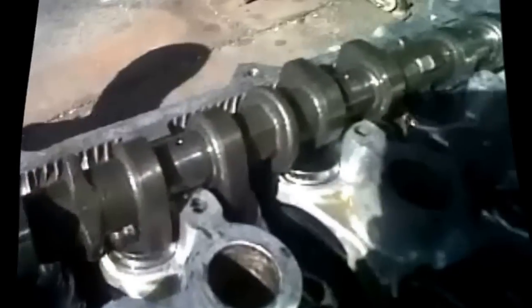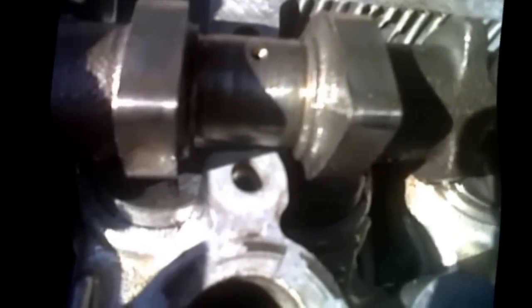You can see this tooth must be inside the other teeth. Now everything is fine. Once we put the tensioner in, it's going to tension the chain on that side. Don't forget — you need to go back just a little bit from TDC so the chain doesn't stay loose. It must not stay loose, so go slightly back, and then we're going to do the same procedure to put the caps for the exhaust camshaft.